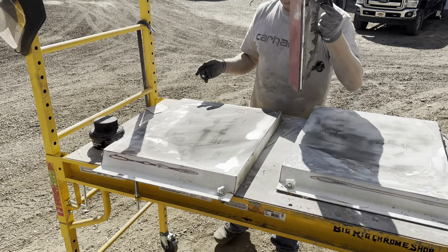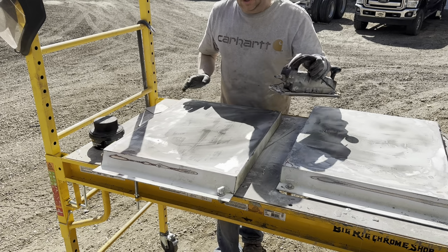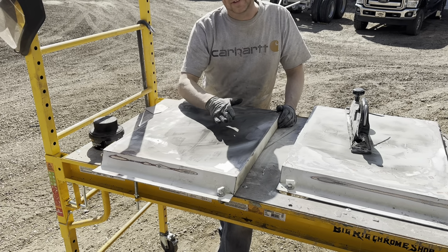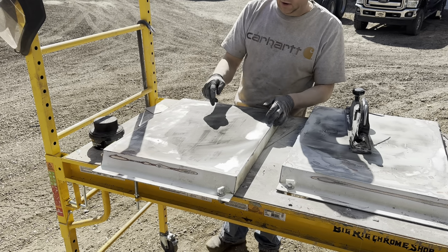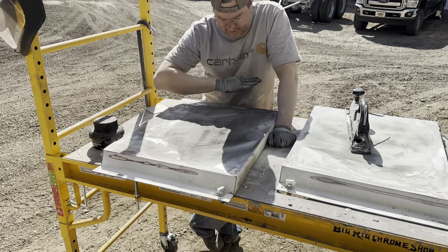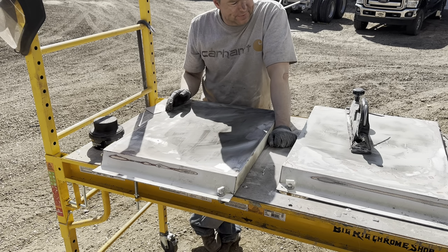Yeah, I'm obviously using an air board, but even if you just were using a long board and sanding that, what that does is it shows you the low spots will stay black and the high spots will obviously be cleaned off and either be metal or filler. So then you know where to put those last little layers of filler in there to get this level.